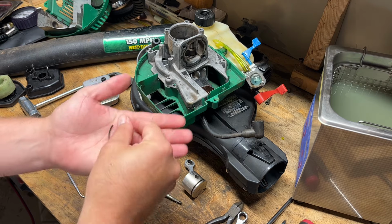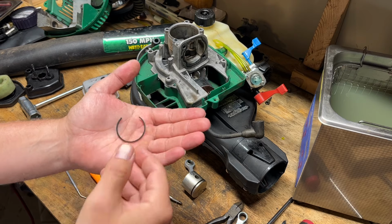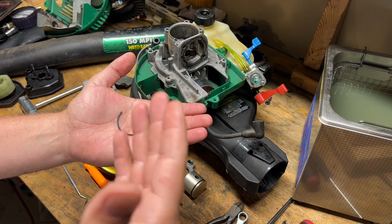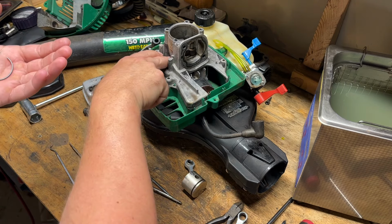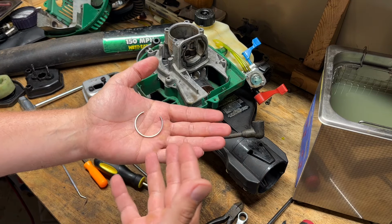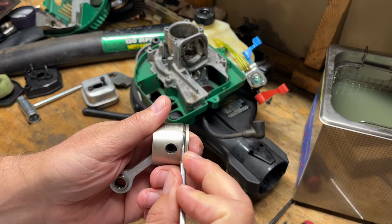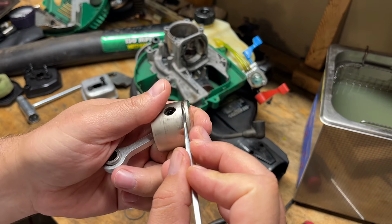Okay, so out of my own curiosity, I had to take a look and see if this thing was even still available online, since this is like 20 years old, and surprisingly, it is. So there was one or two sellers on eBay that still had this. It was like 10 or 12 bucks, and figured, what the heck, let's just get it. Kind of a gamble, since we don't know the condition of the crank seal here, and there was that wear on the bore. But yeah, I'll take the gamble since I kind of broke this thing anyway. So we'll get that on order, and in the meantime, we'll scrape out this ring groove, get it back in the dip to dissolve whatever else is in there that I can't scrape out, and we'll wait for that part.